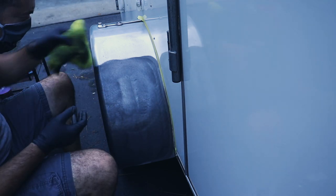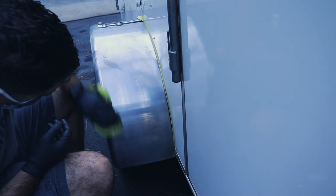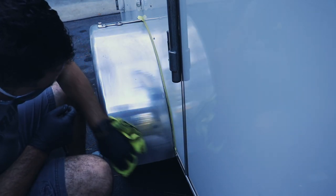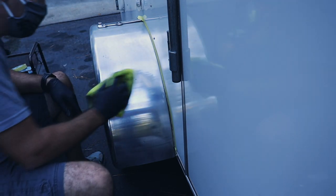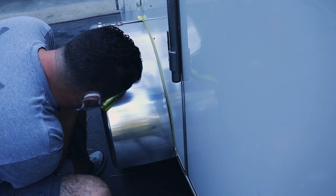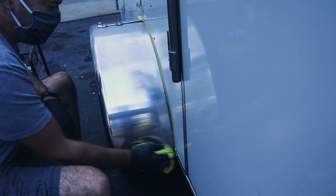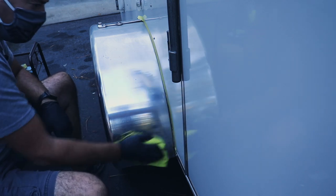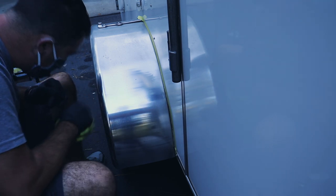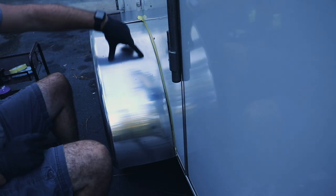You can see I'm treating it just like paint, following the same polishing pattern. It's looking better, but I don't think it's going to shine up like chrome — it's not the same. When you look close it has almost like a grain to it. It might be a different type of aluminum. It's not like a perfectly flat, nice aluminum — you could probably grind that texture out, I'm sure, but I may not go that far. I'm going to keep going all the way up.